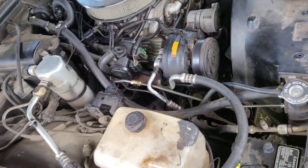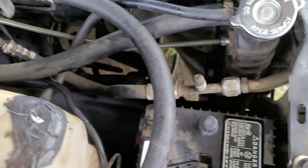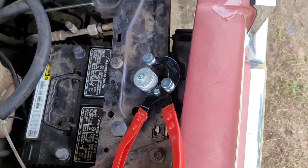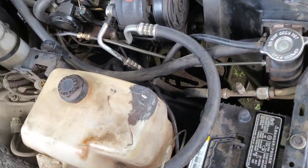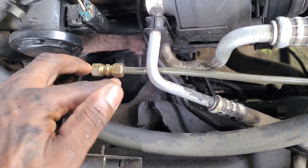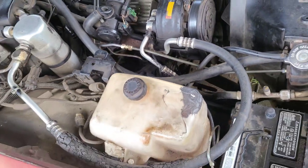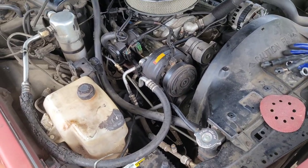All right YouTube, I'm back. I got the line on. As you see, I went ahead and just purchased a new line, and I had bought this tool right here which is a tube bender. I bent it to the size and angles that I wanted, and I went ahead and bought this piece right here that could join the two lines — called a compression fit. So I'm gonna go ahead and get to the next line, it's gonna be the same process.